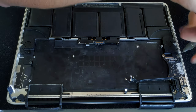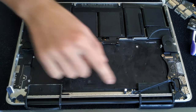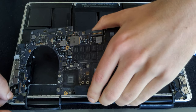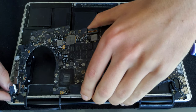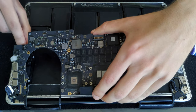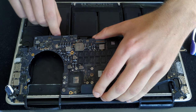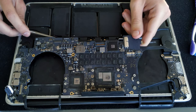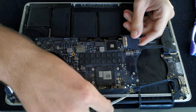The logic board goes back from the left side and the power plug goes first — make sure none of the connectors get in your way. First make sure the power plug screw holes align, then put the board slightly down while making sure none of the connectors get in your way. Push the connectors out of the way using tweezers, and do not forget the little connector at the front.